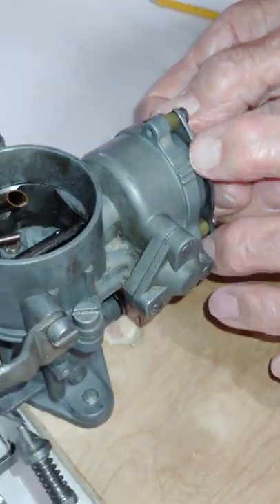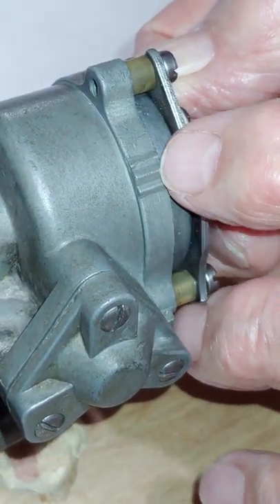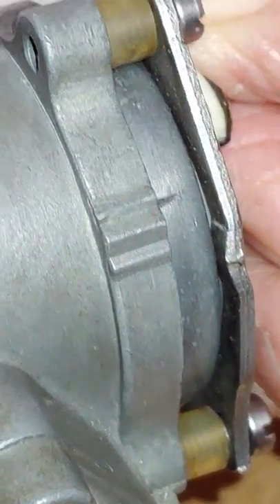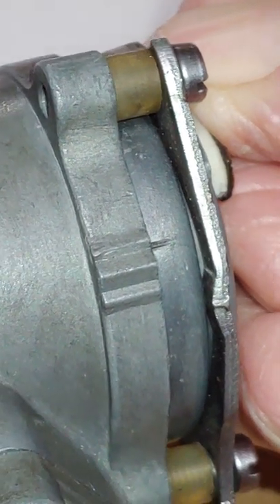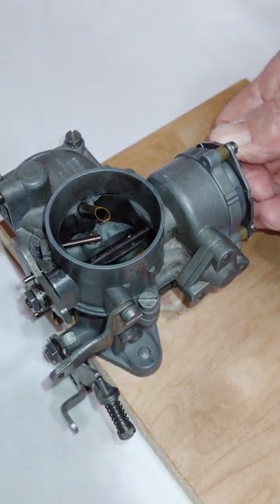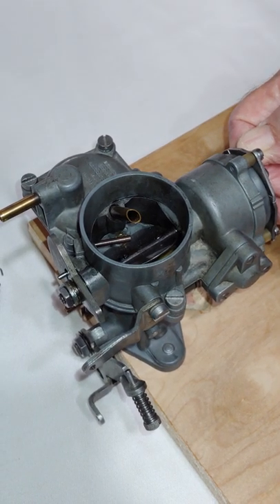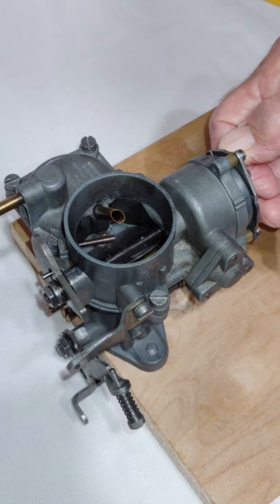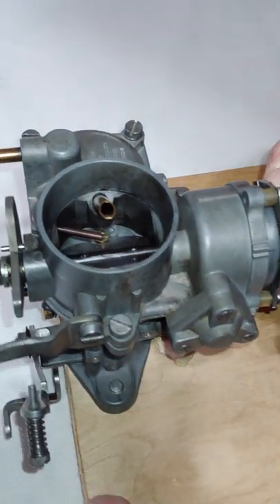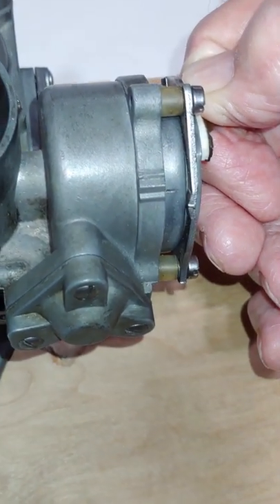Now there's a little casting on the outer edge of the carburetor casting. David Brown calls these pips — there are three of them, one taller and two shorter. We also have a little groove here on the choke heater itself. In the Volkswagen literature, David says there's no mention of whether it's useful in the setting or not. One would think the groove might align with one of the pips, but these were mass-produced, and after 50-something years, maybe they don't adjust like they should. I'm going to set the choke plate a quarter to three-eighths of an inch open, meaning the groove lands right there between the tall one and the short one on the bottom — that's where I like to have it set.